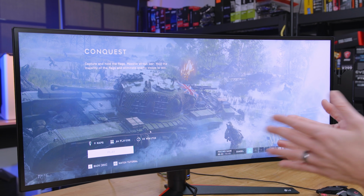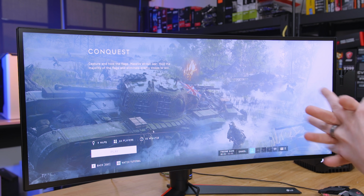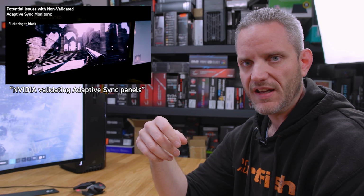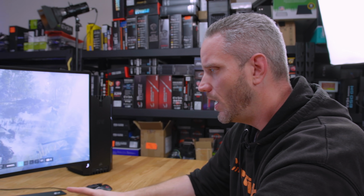So one of the issues we saw with adaptive sync validation with G-Sync was crazy color banding in the sky, especially on HDR panels. There was a lot of stuttering. There were black screen flashes. There were white screen flashes. If you watch our video from CES, I'll try to remember to link it down below. We saw a bunch of different issues with some of the panels that they identified problems with. And I don't know what panels they were because they had tape over the logos, but I can tell you right now, we're testing this with 3 different LG panels.